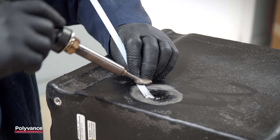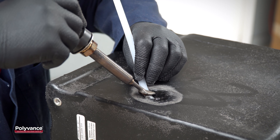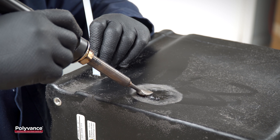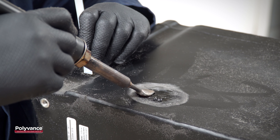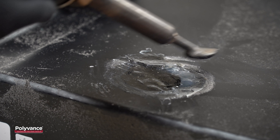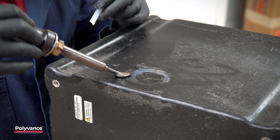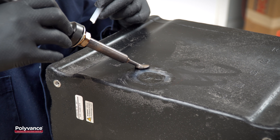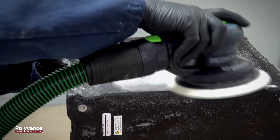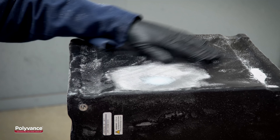After creating the plug, continue applying plastic to the beveled area by melting the filler rod, sticking it to the plastic, and smoothing it into the sanding scratches. Remember, do not try to melt the base material. When the entire beveled area is filled, your repair is complete. If you want, you can sand the repair area as shown here, but this step isn't necessary.